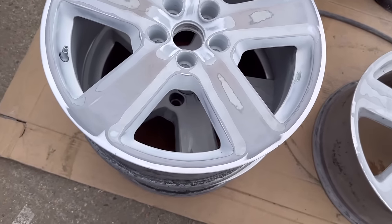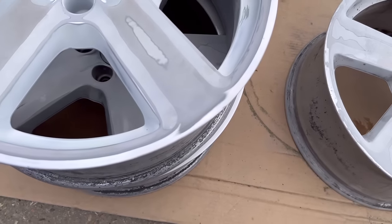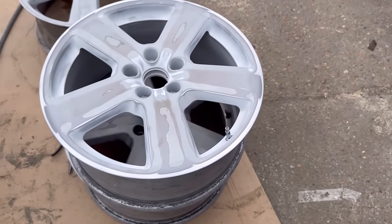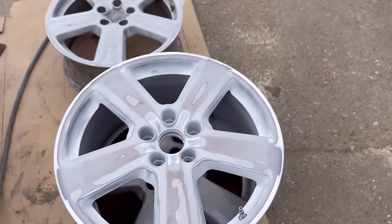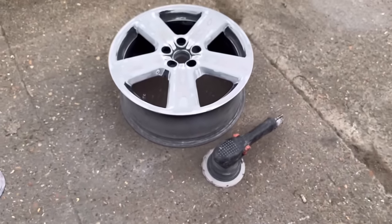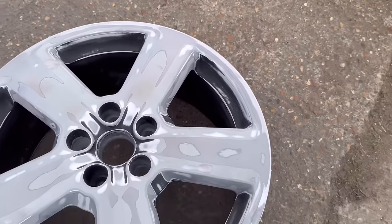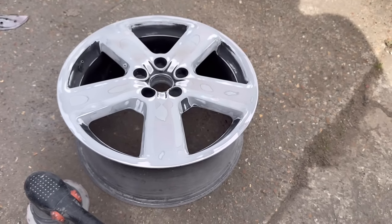Here's one I've gone over a bit more and you can see around the edge I've gone a little bit further — all we've got left is a couple of little chips. You can go a little bit further than you think. Normally when you've got a factory wheel that hasn't been done, the paint's so thick that by the time you've sanded the paint back to bare alloy, you've actually sanded most of the chips out. There are two more to do. You can apply filler in loads of the little chips, which is quite easy.